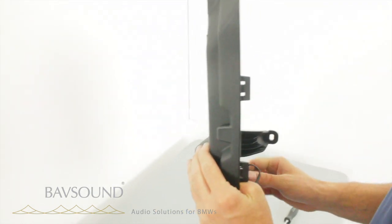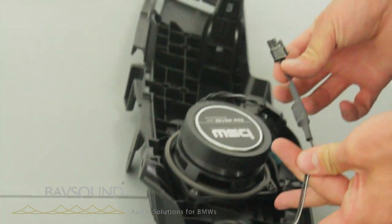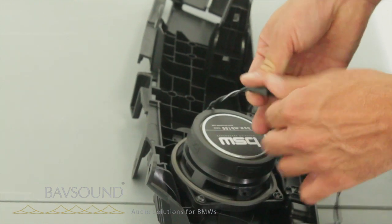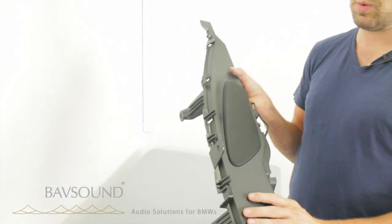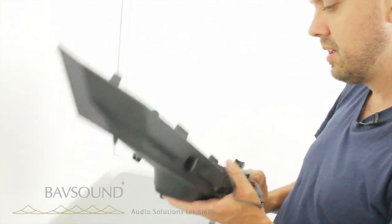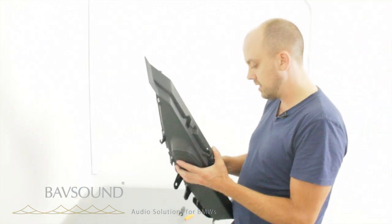Tweeter snaps in and we then plug the tweeter. Depending on when this kit ships, you may actually be clipping in an inline filter. It's important to make sure there is a harness with a little capacitor between the mid range and the tweeter. Clip them together and then this plugs back into the factory connector and we are done. Don't think you can pop this grill out — we don't recommend removing this grill, it's just a lot of work to put it back in. Leave it be because it's fastened down here on the bottom. So with that done, let's take this back over to the car, get it reinstalled, and move on and enjoy the stage one.